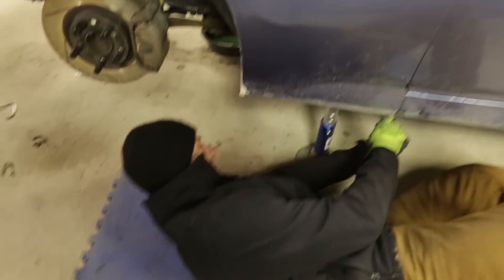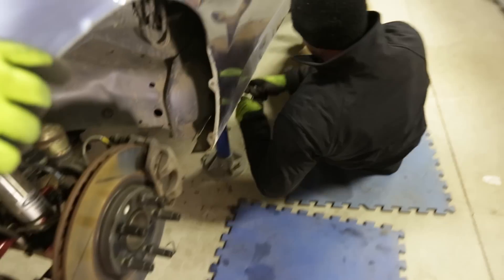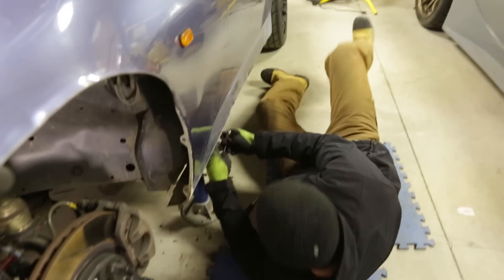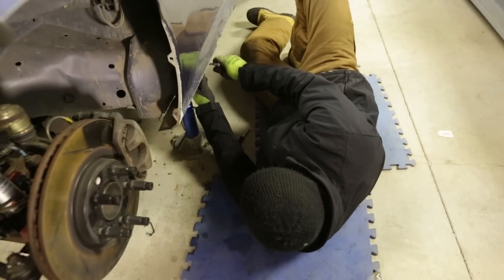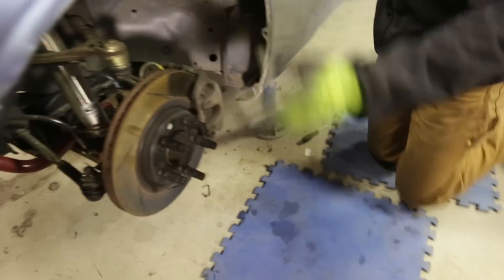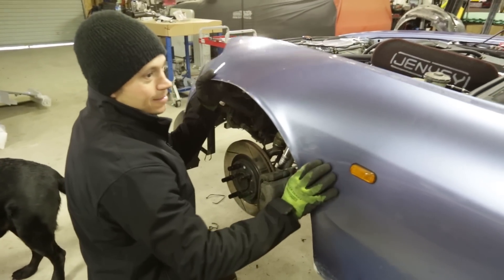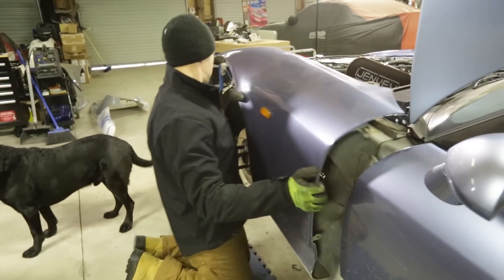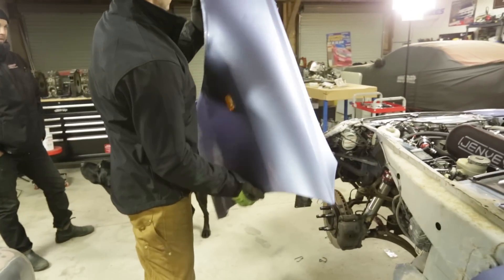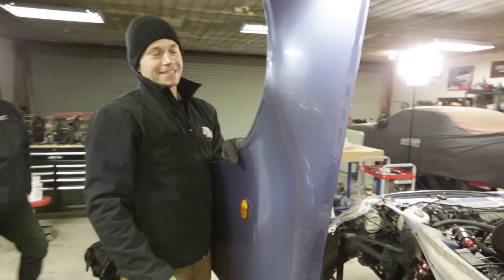Giant fender coming off. It's going to be a shame having to retire this sweet fender roll job that we did — that was a pro-spec fender roller at its best. Say hello to our Downforce USA front fenders. These are 30 millimeters wider than the stock fenders, which is a big part of why we're installing them. We want to run a wider wheel and tire package this year. Our other fenders were also pretty badly beat up, so it's also just a way to make the car look better.